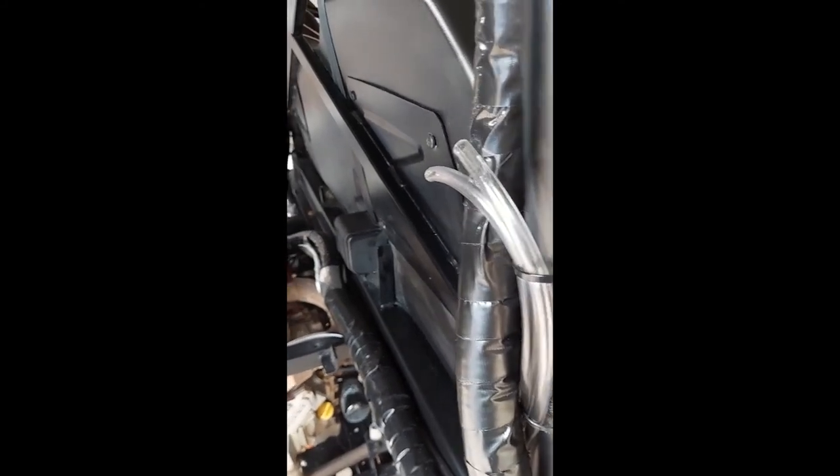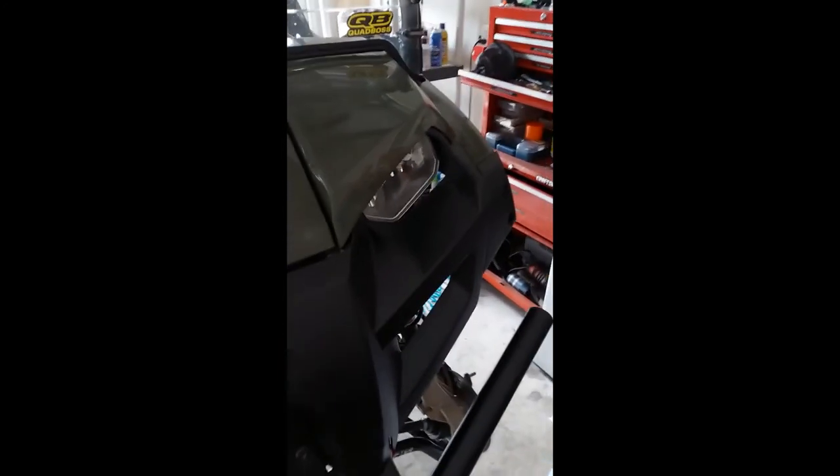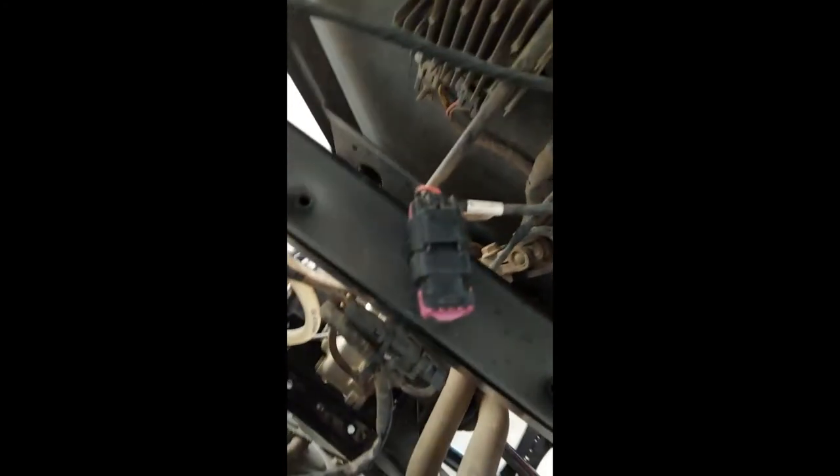Front diff is easy as well — just follow the hose. Pop your little hood and it's extremely easy to vent it. That one, I didn't even use a clear line because I had enough from the factory, coming straight up there. I don't plan on going any taller, so not a problem.